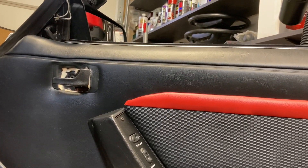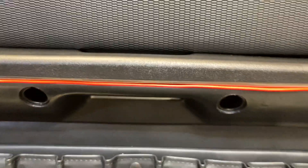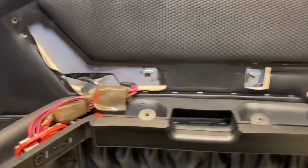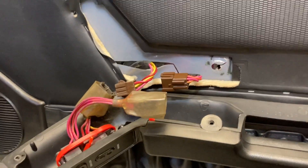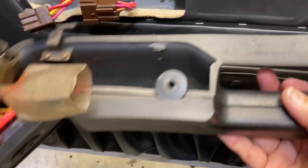Now we're going to pop these little trim pieces out and take the bolts out of the armrest. I use one of these little picks and just work at the bottom to pull it right out so I don't scratch up anything noticeable. Once you get those out, it's a three-eighths to take these two bolts out. With the bolts out, you can flip down your armrest and unhook the two connectors. Then use your pick to help pry off the latches so you don't break them — get your pick underneath one side and use your finger on the other to spread them out, and they usually pull right out.